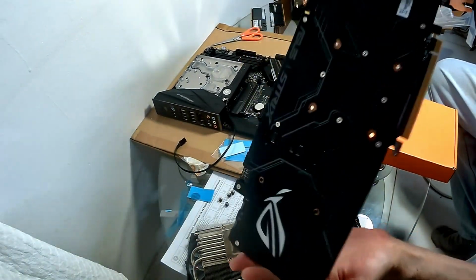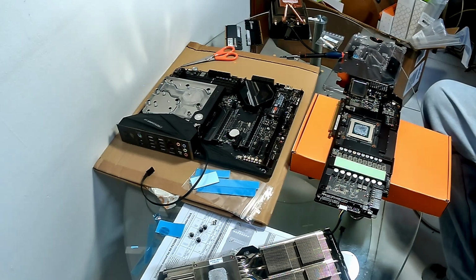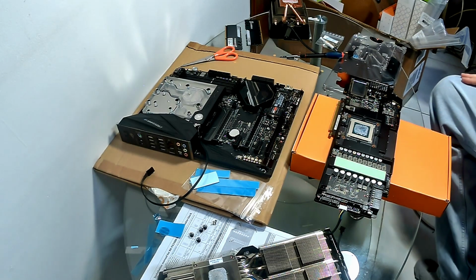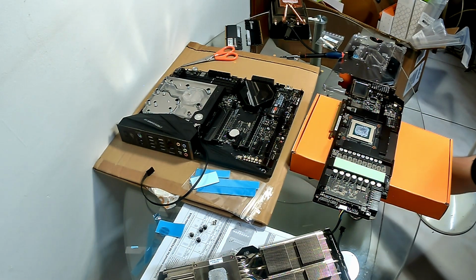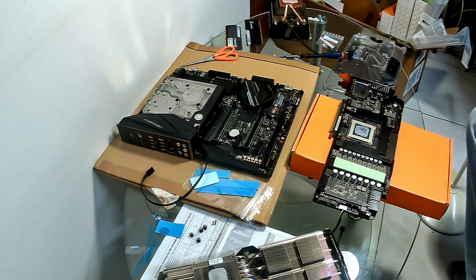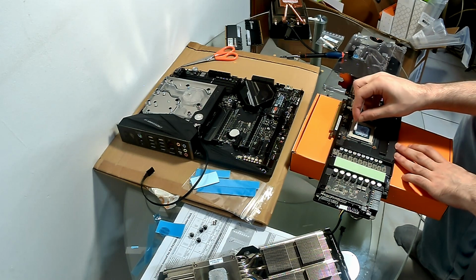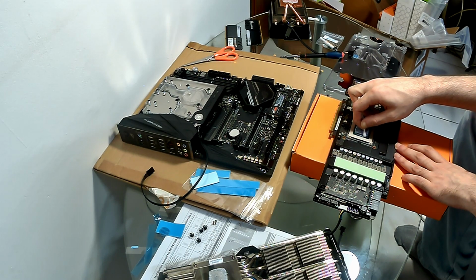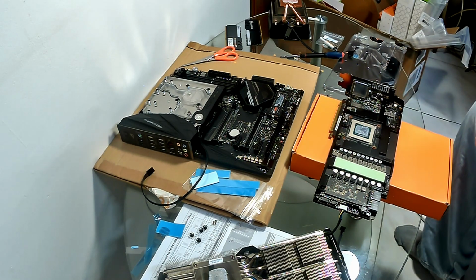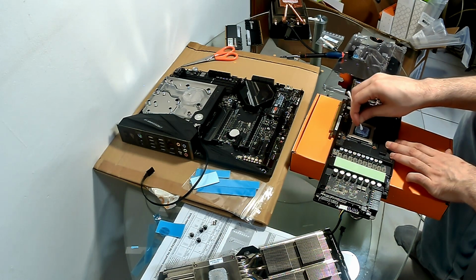getting the cover off. We just have to get the bag and clean up our thermal paste, which I should have the stuff over here. I mean, some people might use, I don't know, isopropyl to get all of this stuff off. Personally, I don't like to add chemicals and stuff on these things, but that's just me. So I'm going to clean all this off.